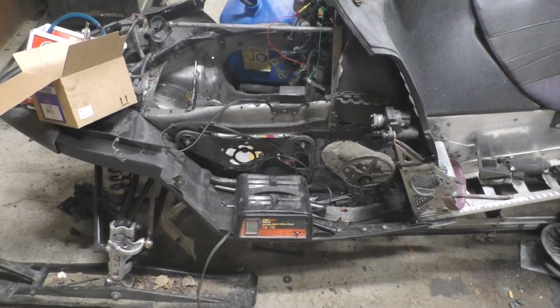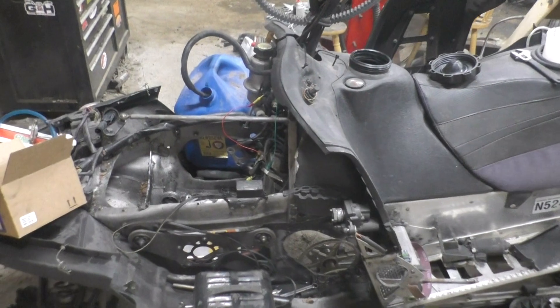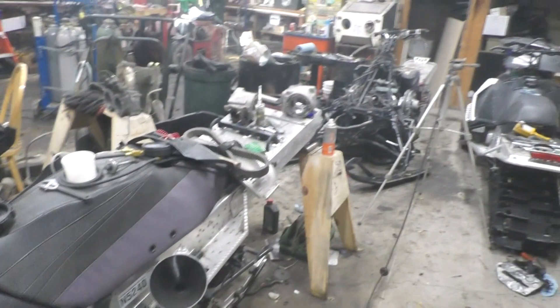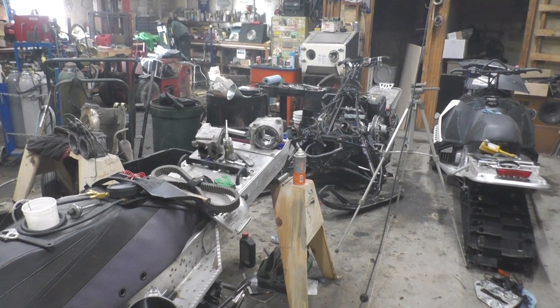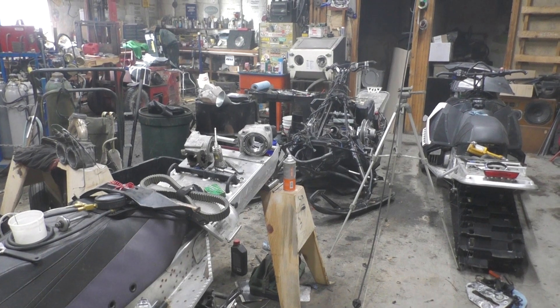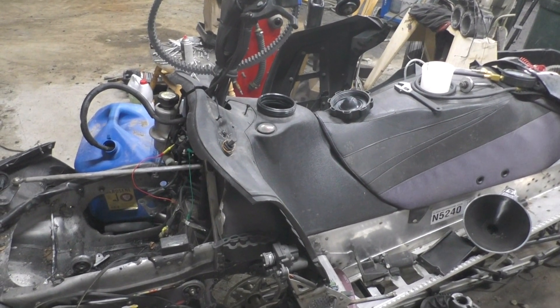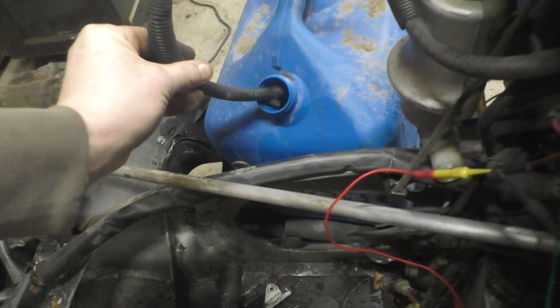Using the battery charger here to pump the fuel out of the old 1000's tank so I can get in there and take the fuel pump out to put in the other tank. The fuel pump and pressure of the Pro Climbs — as long as they've got the Suzuki engine — is actually the same as the 1000's engine, so you could use all the same stuff. I don't have a pump for that one, so I'm going to take the pump out of here. I know it worked good, so hopefully it will fit in the whole assembly. The jug's almost full — time to get a new one.